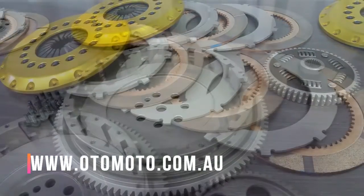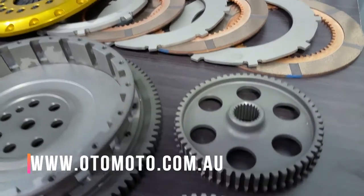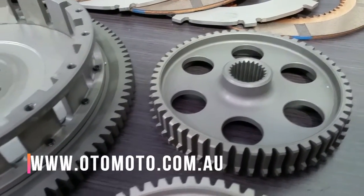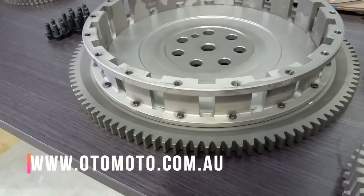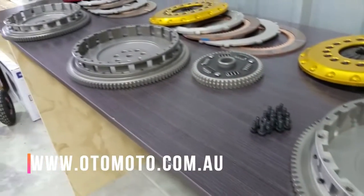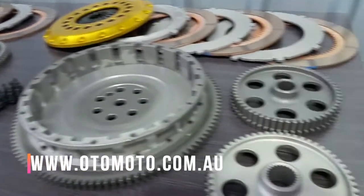The R3C uses the same style of clutch plate on a solid hub. With really big horsepower, you don't want springs in the hub because they will just get destroyed. Another difference you'll spot on this clutch is the flywheel, which is much shallower than the other two. This makes room for the triple plate to fit in the bell housing of the EVO, bringing the overall weight down to 13.7 kilos.